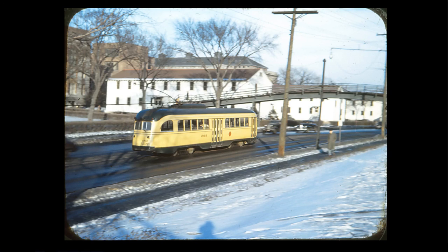In 1945 they decided to try one of these new modern PCC cars, which had been around since about 1936. They diverted one car headed to Pittsburgh to the Twin Cities — that's car 299. It's different from their car 322 in several details: no small standee windows above, a flatter windshield, a more sloping back end. Car 299 is an air-electric with air brakes and air doors; car 322 is an all-electric where everything including braking systems and doors is electric with no compressor. They really liked it, it stayed until end of service, and then they sold it to Mexico City.